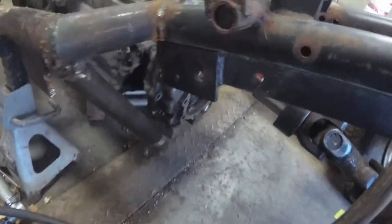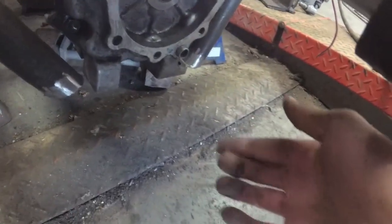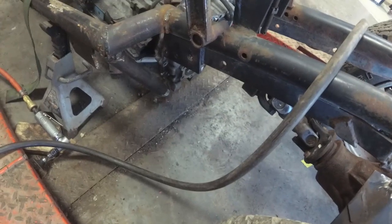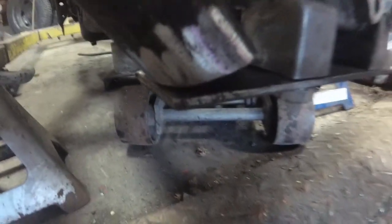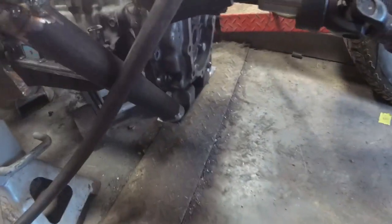You can probably see the idea now. Those tubes are welded on — there's one over there. They meet up down there, and a flat plate's gonna go across there to bolt to the tranny, and that will mount the back of that nice and solid. Made a little plate there that bolts on. Just getting ready to weld that on — and that will be the rear mount.